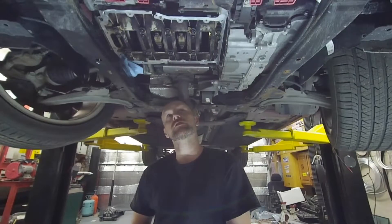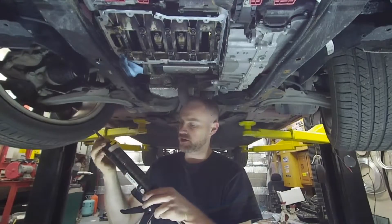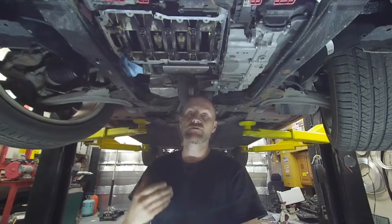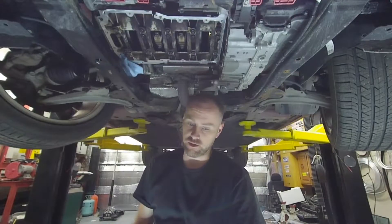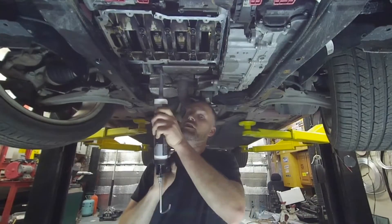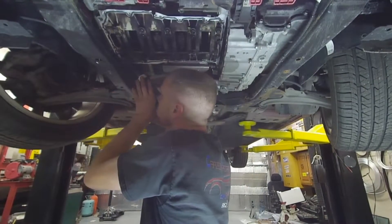The stuff I use for this is a RTV style pan. One product is the Mopar Black — it's actually a pretty good RTV product. But this Right Stuff is also extremely good and is what I use for pretty much everything. It seems to really work well, especially in situations like this where you might end up with oil running down — it will still adhere and still seal. On the oil pan I made sure to put some silicone lubricant where the dipstick tube is going to go, and I'm putting that up into place at the same time as I put the pan on the engine.